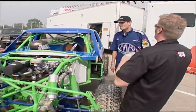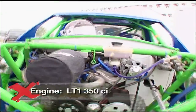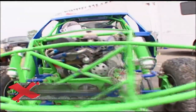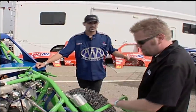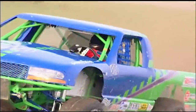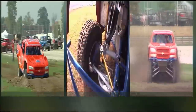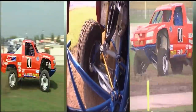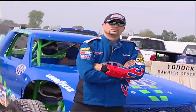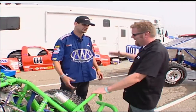Chris Mosier, tell me about the differences between the old General Lee and the new one. The older truck is still running the old Corvette motor, the LT1, all cast block. It does have the aluminum heads, doesn't have the sleeves, not bored over — still a stock 350 bore. He also has a Ford 9-inch in the front end, which is a little stronger. I'm running the Dana 44 with a clear cover so I can see the gears — admittedly not the stronger 9-inch. He's got a little more stable landing so he gets no hop, no bounce — his power's to the ground and staying to the ground. Chris knew he was outgunned but was confident of another victory: 'He just better be on his game, because I'm coming for him.'